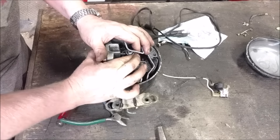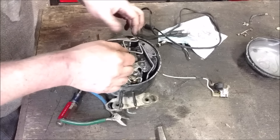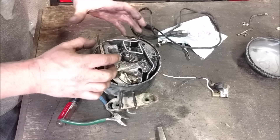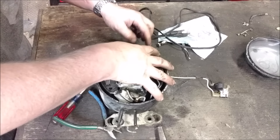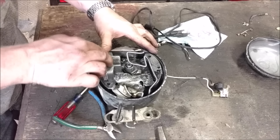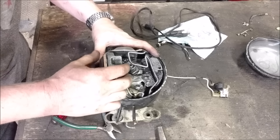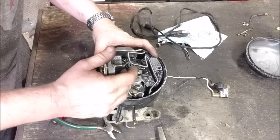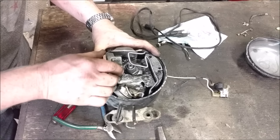It compresses it and then pushes it through this line back and forth, and then this line directly comes here, pushes it out and does the refrigeration. They don't want the vibrations to go through the whole refrigerator, so they have this entire unit mounted on rubber feet, and then this is on spring suspension. It's this huge cast iron piece so that the piston moving back and forth doesn't jostle things too much.